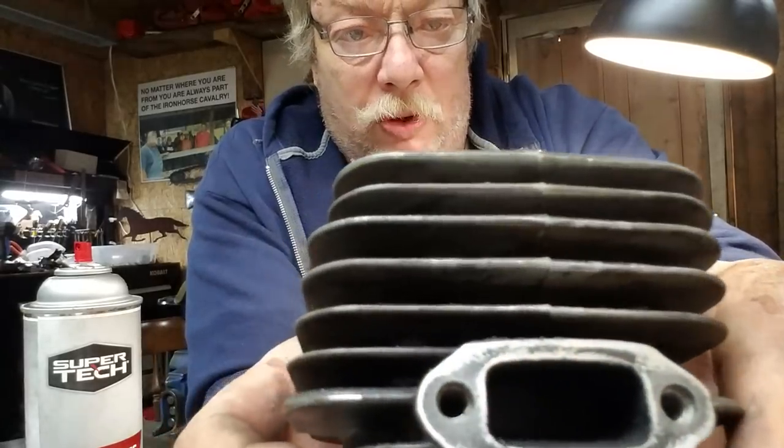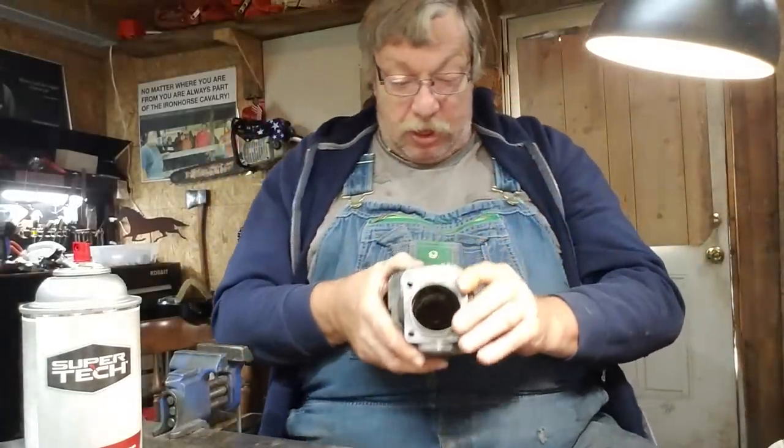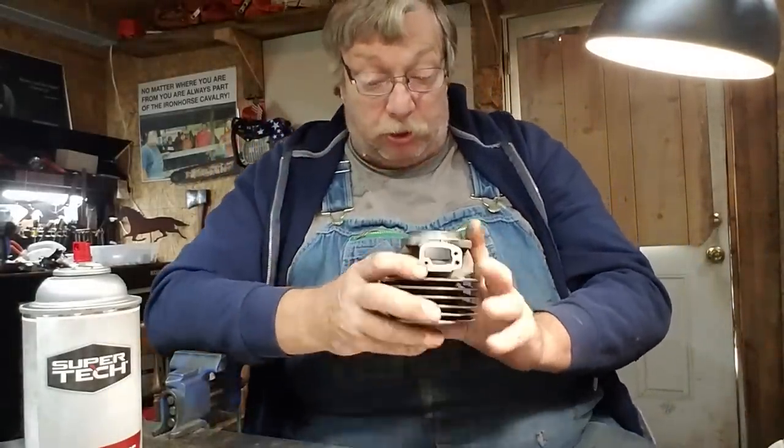Don't put too much pressure on your file. And if you think your file might not be absolutely flat, turn it over — you'll see the witness mark from the file change. That'll seal right there. You can feel that with your fingernail — that'll seal good. It probably would have anyway. Don't leave carbon on these things sticking up — that's what your problem is.